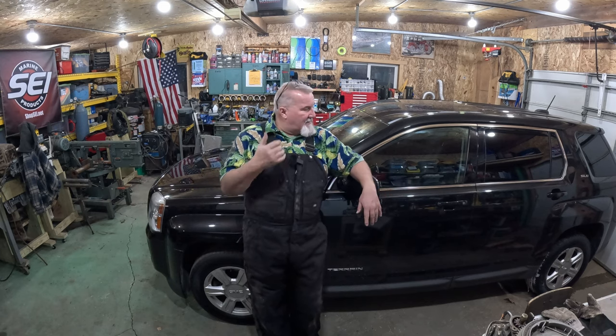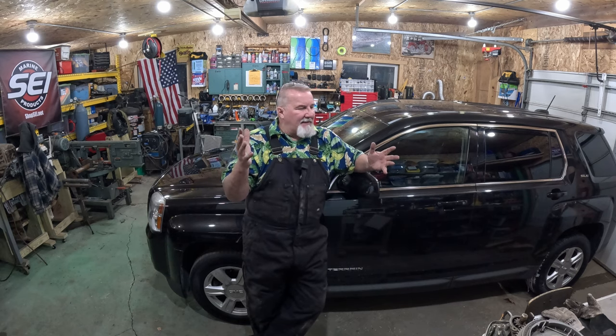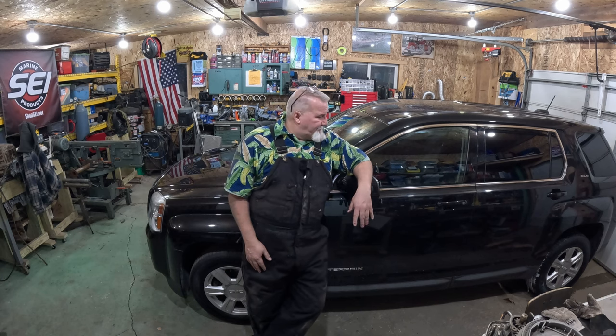Well, folks, that concludes this video. We have the muffler in. We made a lot of headway on this car. We got the new muffler installed. You might have seen I put a sleeve in there. And the inside of the exhaust, guess what? There was already a sleeve from the factory in there, the same thickness as what I put in. And I just used that for a backer inside, so when I welded around it, it would lock it in place, and it wouldn't burn through so easy, and we got nice hangers on both sides.